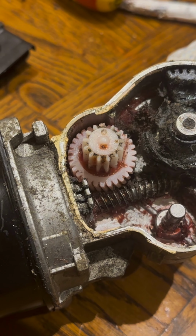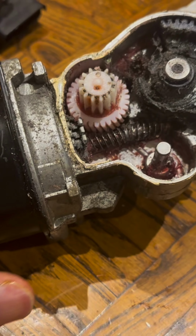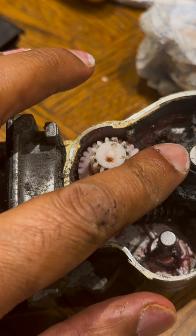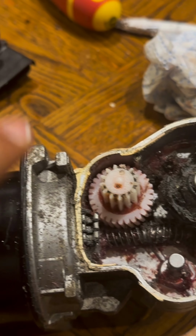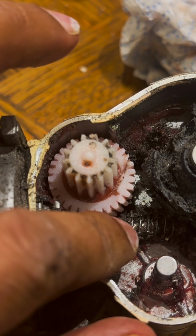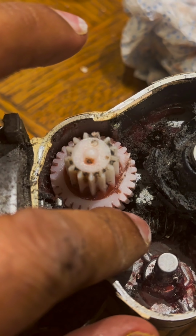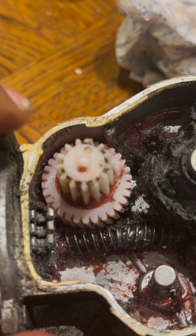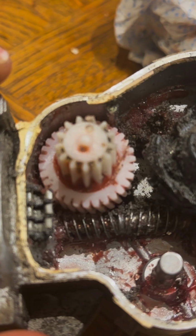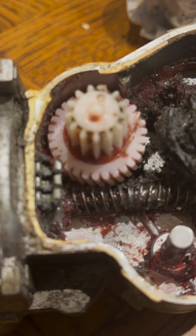So there we have it. Okay, what I've done is I couldn't get this to lift off. It's a friction grip onto that, really tight. There may be some other form of location, but I've now exposed this drive here, and you can feel with your finger it's absolutely razor blade sharp and bent. The actual cogs are just bent to bits. So I think that's where the failure has occurred.